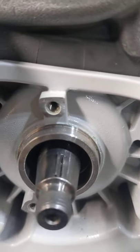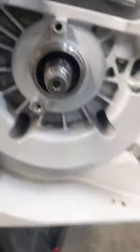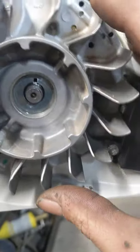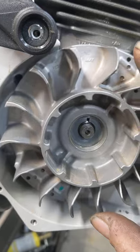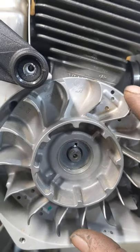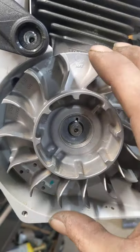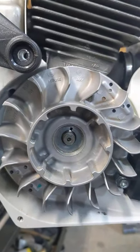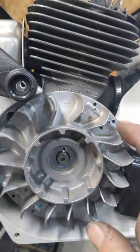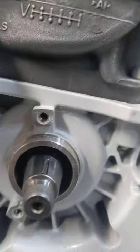Now I step this key — no specific amount, I just put a step in it. Why I step it is because we can turn this back. When we put this on, we turn it back against that key right there. This is factory timing. We can only advance — we can't go back with it, only advance. If you file that whole key, it's going to be loose in there and you're not going to know where it used to be. Right here, that's where it was — right up against the key. That's where it was from the factory. You can see how I did it because of the step.